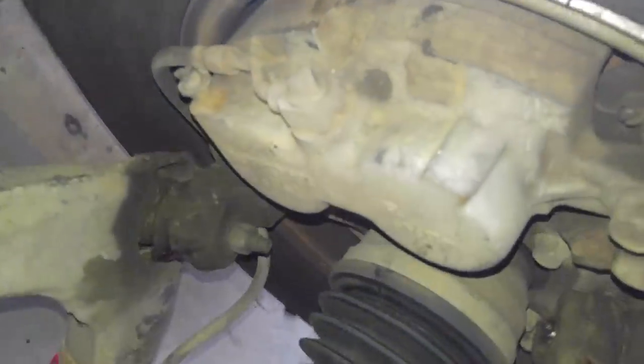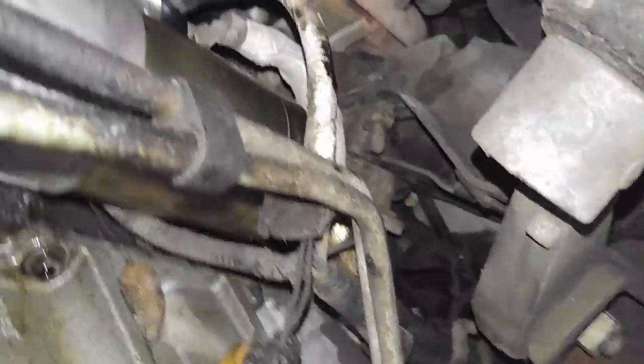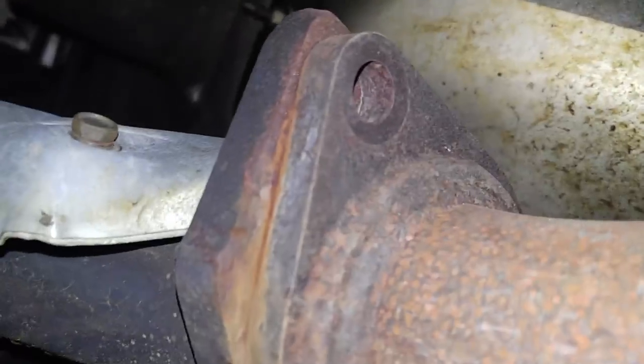It's definitely up here — what a racket. My front suspension needs to be aligned. My brake bleeder covers — nice grease inside my ball joint boots. My bumper is rotted right off. Look around and sometimes you find things that are loose, falling off, rubbing — you never know. That's why you do a visual inspection. K&N oil filter, grease fittings on the U-joint. Oh look at that — missing an exhaust bolt. I don't see any signs of exhaust leak but you can see a little bit of black smoke. You never know what you're going to find when you do a visual inspection.